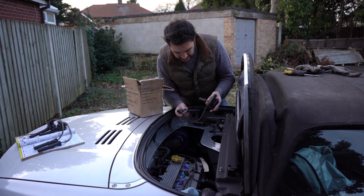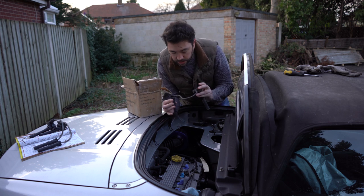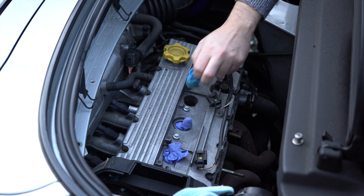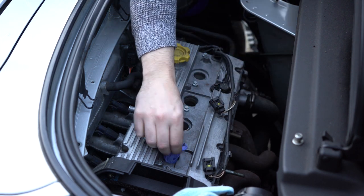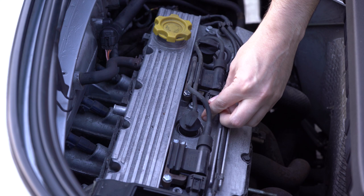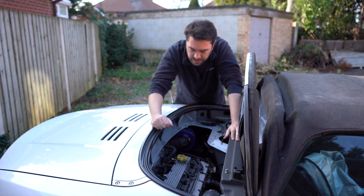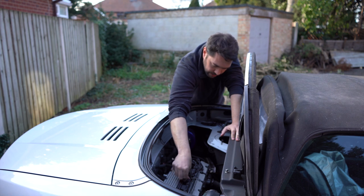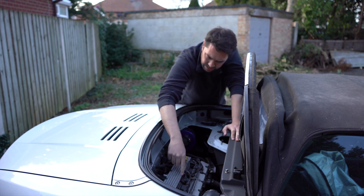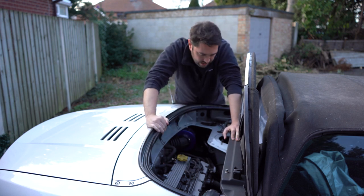So I've been and bought some second-hand ignition coil packs and I'm going to get them plumbed in now. I've no idea if these work or not, hopefully they do - we'll find out. I'm not sure these are the correct ones for this engine because while they're touching the spark plugs, they sit proud and too tall - you can see them moving around and they don't seat into that recess. I don't think they're the right ones, but I think it'll start. Anyway, I'm going to put some oil in it and change the oil filter next.